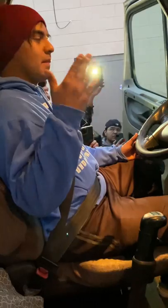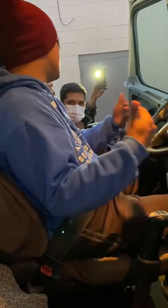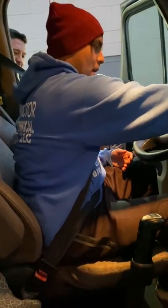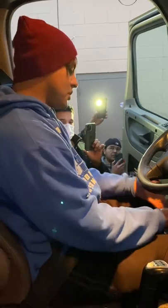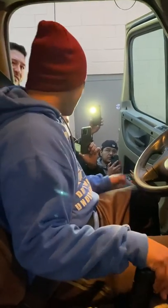I'm gonna move forward up to 5 miles per hour and then I'm going to stop. I will check at the same time that my speedometer works properly. I will check my truck doesn't move to the left or the right. And the most important thing is to check the service brake stops my truck. Okay, I'm gonna do it, guys. Okay, watch out. Well, I'm gonna move, guys.